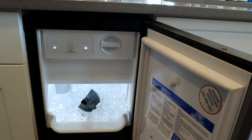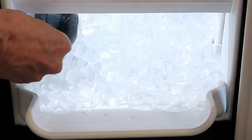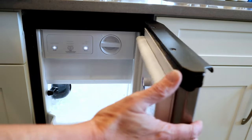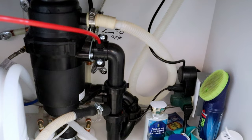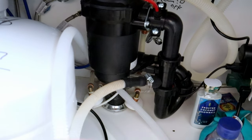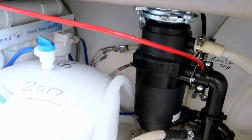One of the drawbacks is that sometimes the scoop holder does get some ice in it. You've got a little scoop holder right here, and sometimes you have to push the ice out in order to get your scoop back in — totally a first world problem. Hooking this up is very straightforward: you've got your power right here with a standard power plug, your drain hose here as a standard drain line, and your half-inch water line right back here. As far as sound goes, this is honestly a really quiet ice maker. I'm going to be quiet for just a second — take you right down near the floor to see if you can hear anything from that motor.